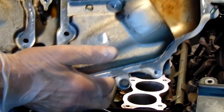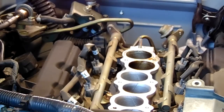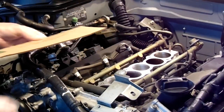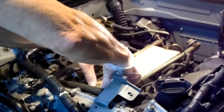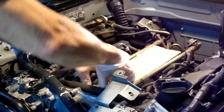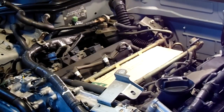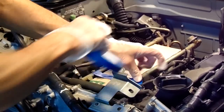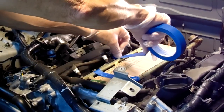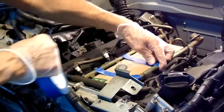You can see some more oil getting into the intake manifold itself. Go ahead and wipe all that up and clean it, then put a piece of cardboard over the opening to keep any bolts, nuts, or debris from getting lodged in there. That's the last thing you want in your intake — so cover it up and make sure it's secure.